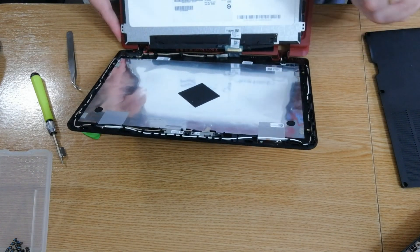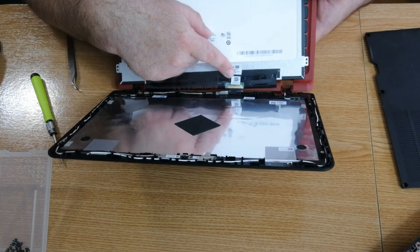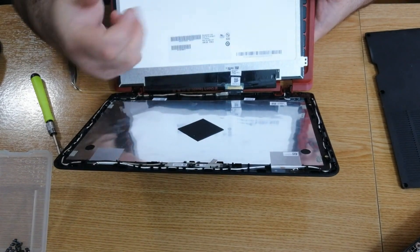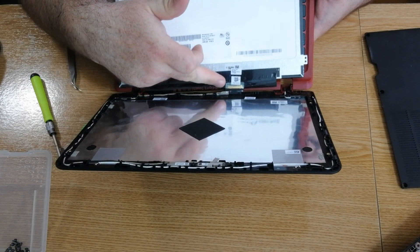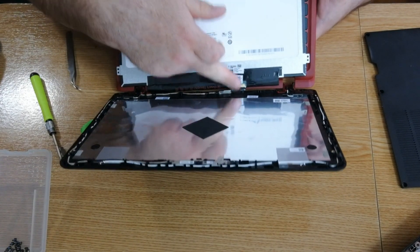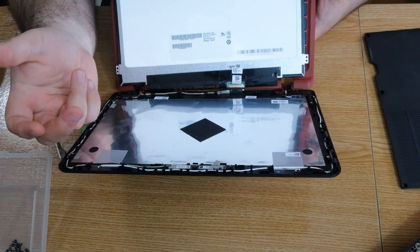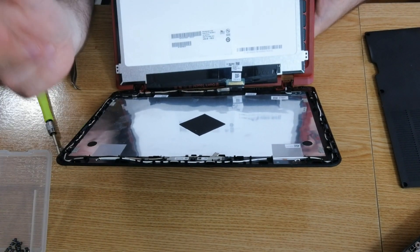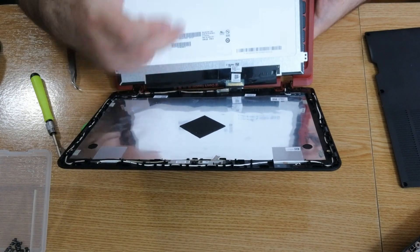This is a 30-pin cable, so it's very important that you take the battery out first. This ribbon carries 19 volts and 3.3 volts. If you don't disconnect the battery and you're not careful when you put the ribbon back in, you could send the 19V rail onto the 3.3V line — and hopefully you'll just get a blown fuse, but in the worst case scenario, no more picture.